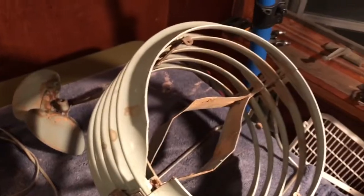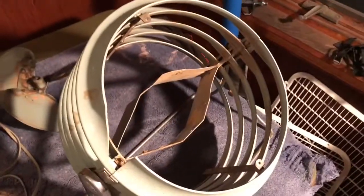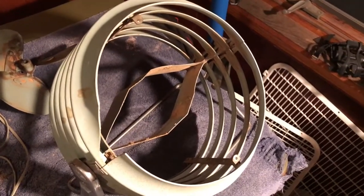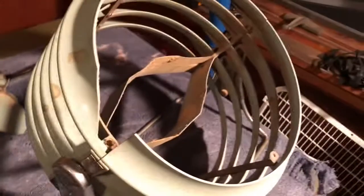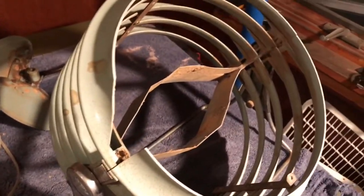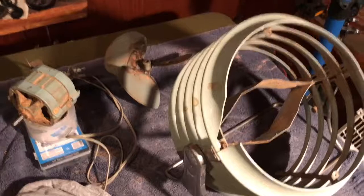Except that it's made out of plastic, which is kind of a dumb idea. The bigger Riviera fans have metal rings, and those are obviously better. Plastic is just a bad idea — because we're gonna break it! I've decided just to glue it together and hose it out. This metal thing is folded in on itself — I think there really is a screw under each one of these, but there's no way I'm getting that apart. So we're just going to focus on getting the motor cleaned and oiled, and clean it as much as we can and see if we can run it. That's the plan on Little Westy here. It's been an interesting ride — I'm sure it's got more secrets to tell. Stay tuned for more videos on Little Westy.